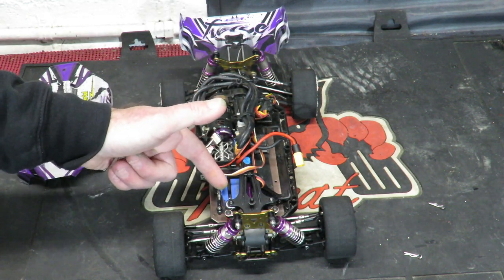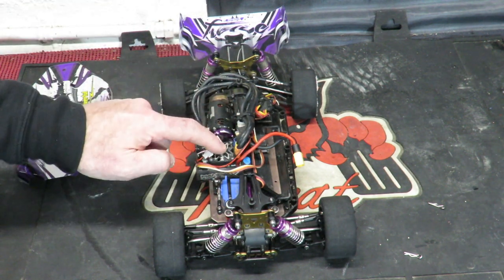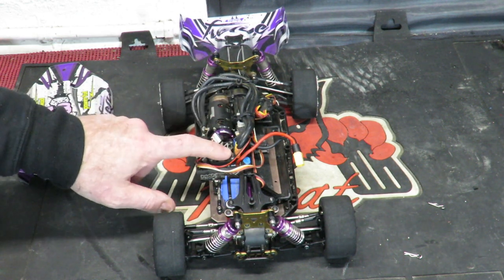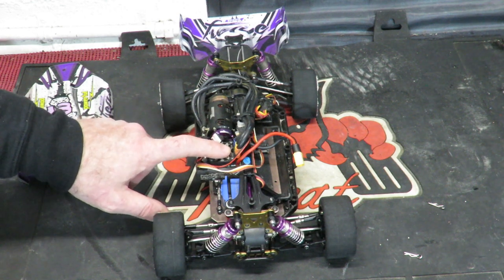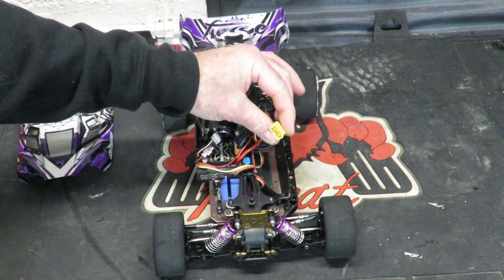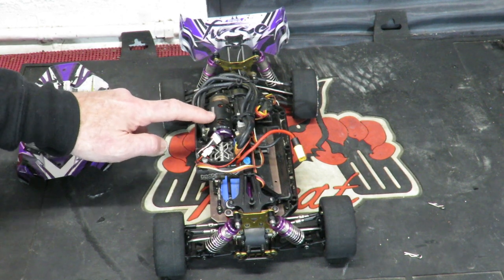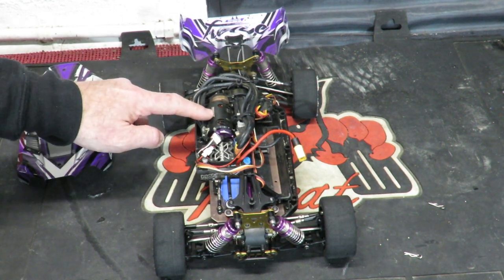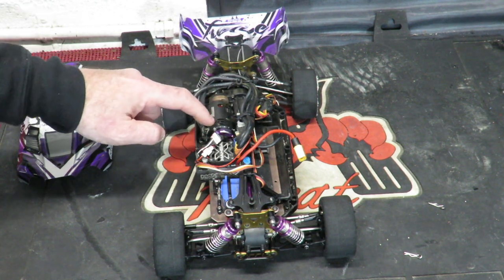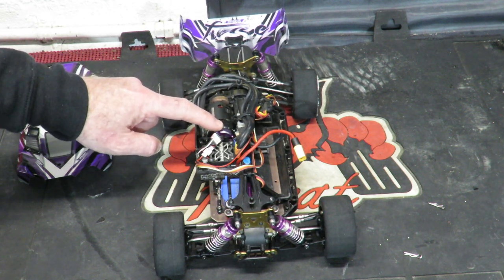I may get a little bracket made up or pick one up at my local hobby store. Mamba X ESC - probably the single biggest expense of the car. I actually blew one of these the other week on the learning curve of getting this to go 100 miles an hour - albeit a very old one. XT60 plug for the battery. This brushless motor is a three and a half turn rocket motor with adjustable timing on the back of the can - you can go from zero to a full 60 degrees. We're set at 40 degrees at the minute.